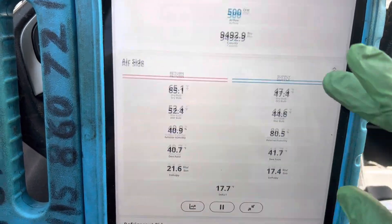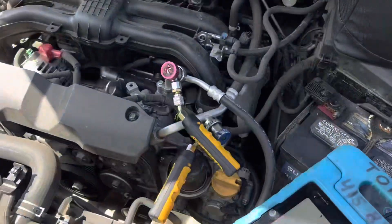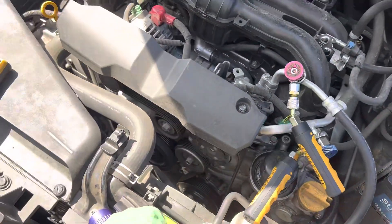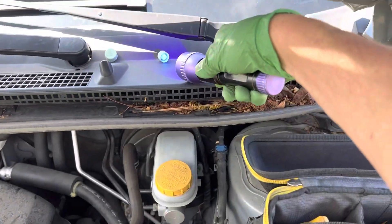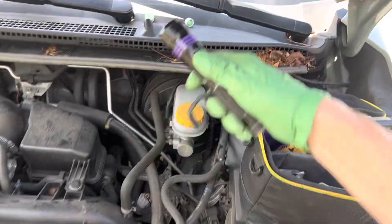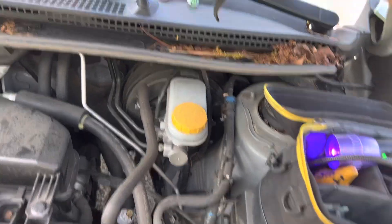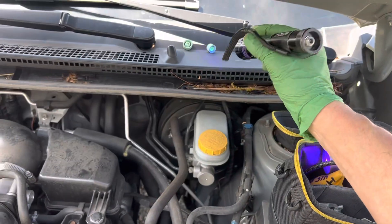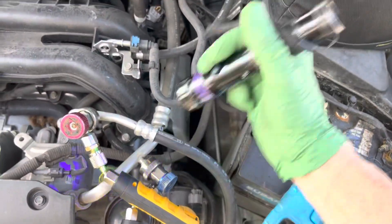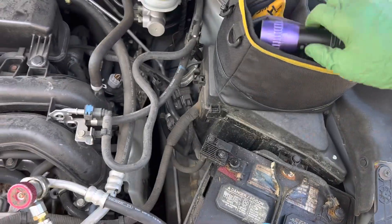What we have here is a 2017 Toyota Tacoma, and on this Tacoma it came in with only 15 psi of refrigerant. I filled it up for testing and looking for leaks. I did notice somebody worked on this before — can you see the glowing under the cap? Somebody added dye in here and didn't tell anybody. I don't see it in the high side cap, so it's likely someone who just had a little can and put it into the low side only.